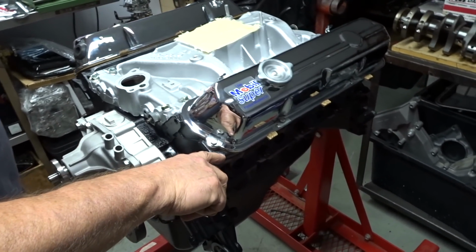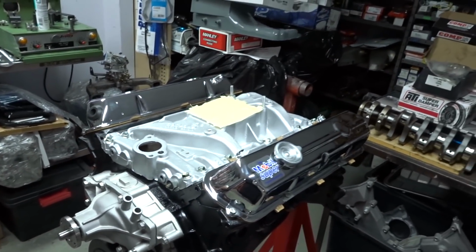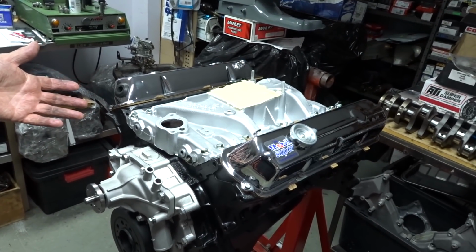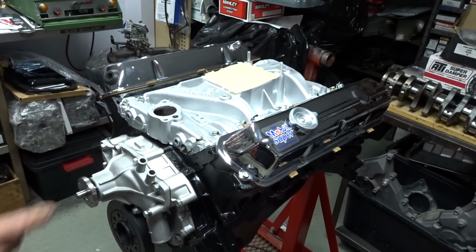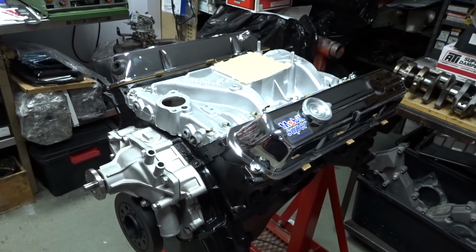So they've got that stamp there, HDT. All the business. That's what the fans want. That's just a basic 308 5 litre. I put a Crane cam in it and I ported the heads for him and sort of did a few upgrades while we were going, but all the original parts are there, in an original manifold.